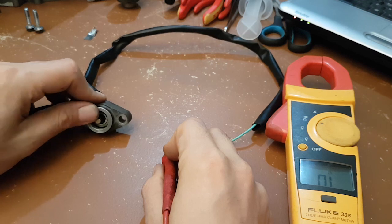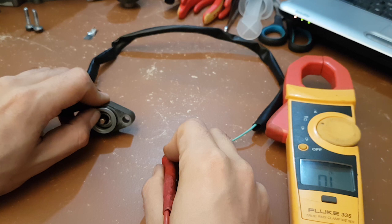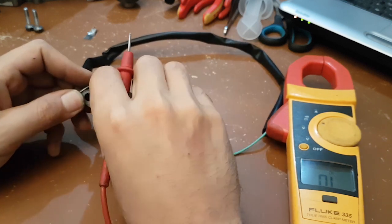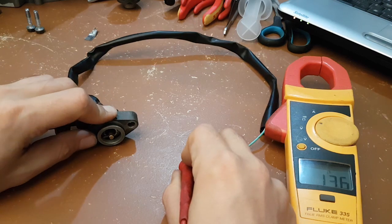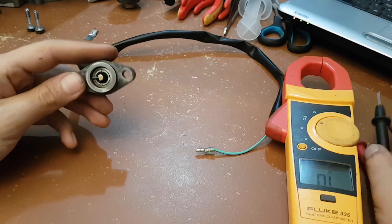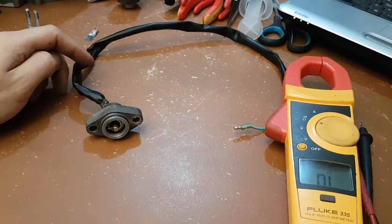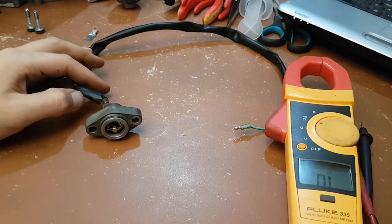Let's put it back slowly to where it should beep — back to neutral. It should be somewhere around here. Yeah, as you can see, we have the beep again. This is how you can check if your neutral switch is not working, or find where the pin is at neutral. It's fairly easy if you have the right tools. Leave a comment, subscribe, and thanks for watching.